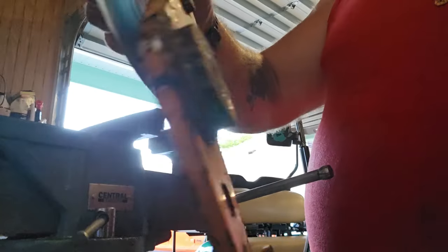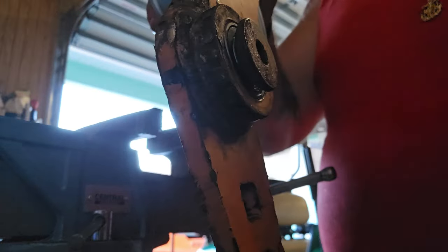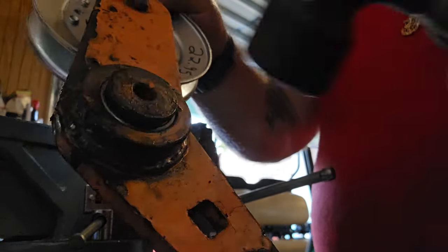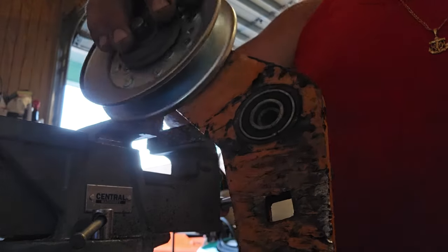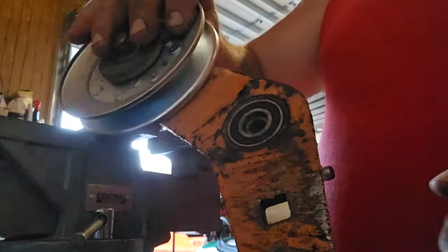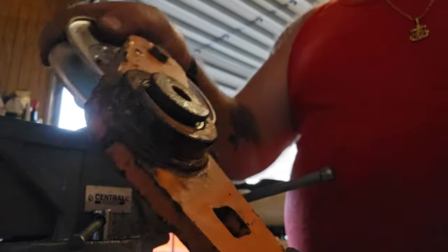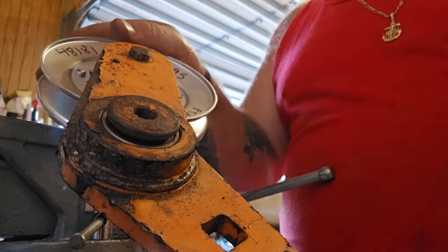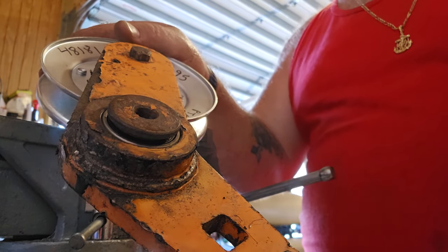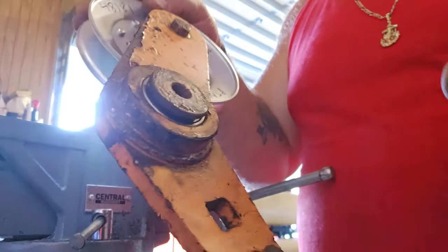So then when you put it back in, pulley's facing up. This bushing goes in here. That goes in there and then your bolt that pulls it to the deck goes up through — just like that. Spring goes on the bottom. Well there we go — bearings installed on the idle arm on a Skag Tiger Cat, 52 inch cut. That's how I did it. I'll try to show you some video when I try to get these other bearings out on the other idle arm. I'm going to put this on and keep on moving.